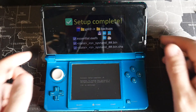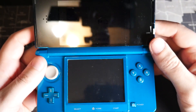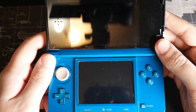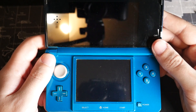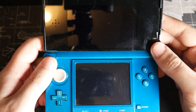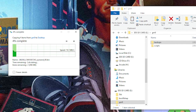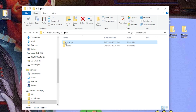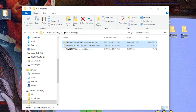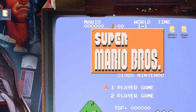When it's all done, it'll say setup is complete. Press A to continue, which will power off the device. There are two things left to do: take the SD card out and save your NAND dump to your PC for safekeeping — if you ever break your console you'll want these files. Go into the gm9 folder, find the backups folder, and drag it to your desktop. Once transferred, you can open the backups folder and delete the .bin and .sha files to save space on the SD card. Keep the exefs on the SD card, then eject and head back to the 3DS.